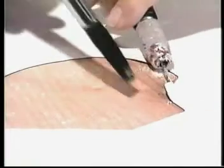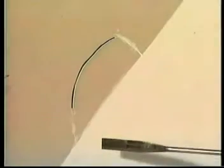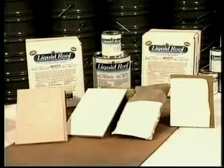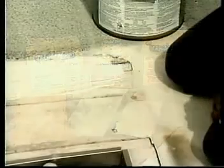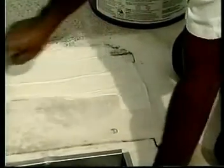The first step in repairing cuts or tears is to reglue any loose edges with contact cement. Small gaps can be filled with a butyl caulk and top-coated with liquid roof. This results in a smooth look, and coating over the filler material gives it the same weathering characteristics as the rest of the roof. If not done, the caulk or filler will weather at a more rapid rate than the sheet, leading to a future problem at the repair site.